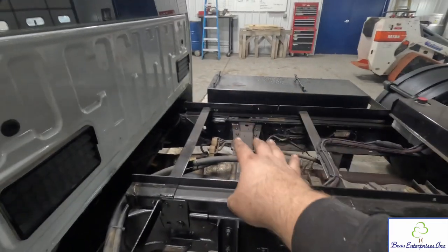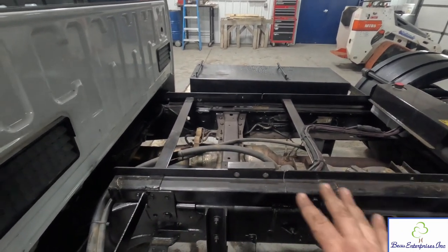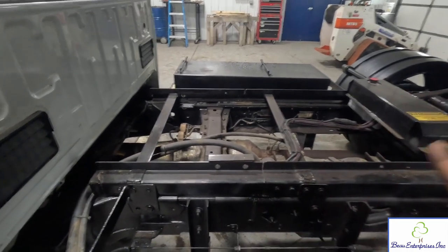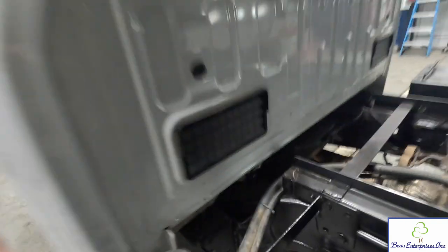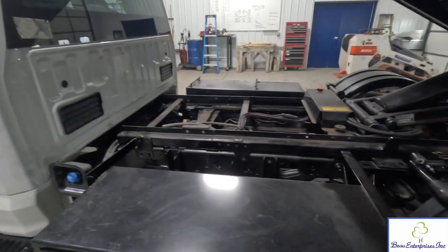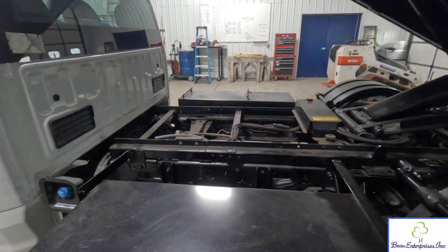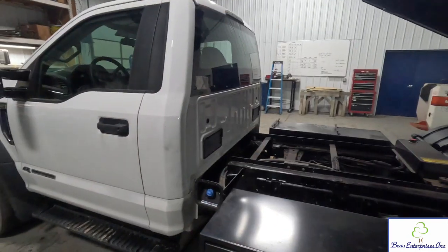You had to get all the wires in the right place — all this nonsense. Now it's a simple plug. In this case, I brought the wiring down along the frame here and it comes up in the cab, back of the cab right here. I drilled an inch-and-a-sixteenth hole, got some grommets, grommeted it, and sent the plug through. It's a really small wire with a big plug on the end, so it's kind of tough to drill any smaller than the size of the plug. Then I ran the controller from the cab back — it kind of just sits up in here and pops out behind the seat.